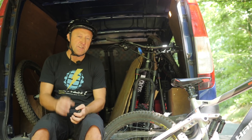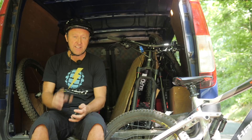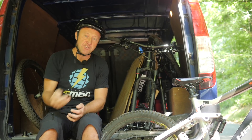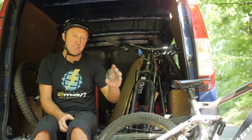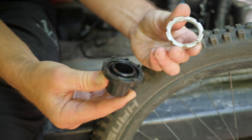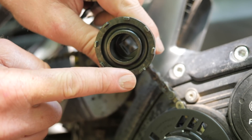I just want to point out that we are focusing solely on the Bosch system in this video today. If you decide to go and get some smaller chainrings, there are a few things to bear in mind. The chainrings are available in 14 to 22 tooth, but if you buy the single chainring only, don't forget that usually there's a bash guard that comes off that motor — you'll need a substitute bash guard to go back with the chainring when replacing it. You'll also need a lockring tool to get the lockring off, and that will also come in handy when you tighten back up the bash ring onto that front sprocket.